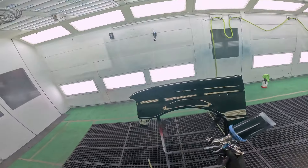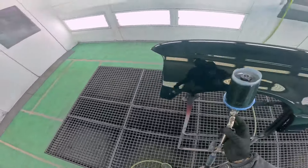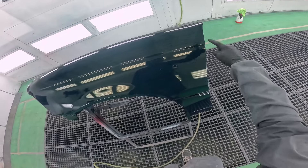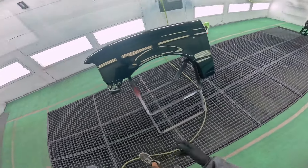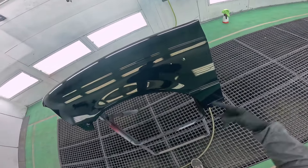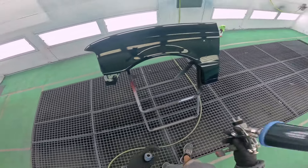So that's one coat. One thing I wanted you guys to pay attention to is how I applied both my sealer and my base coat and how I go past the ends when I'm making my overlaps. The reason you want to go past the end is because you don't want to build up on all of your edges — you don't want to have a bump there. If this fender was on the vehicle, I'd be spraying onto the masking. Just good practice — it avoids buildup on edges.